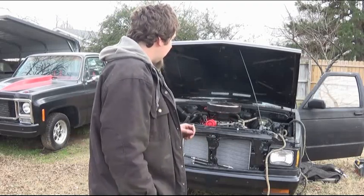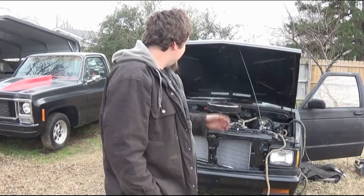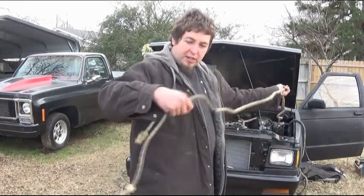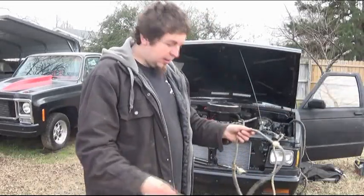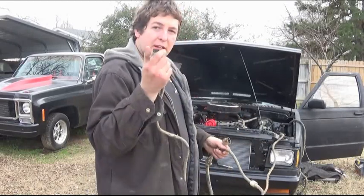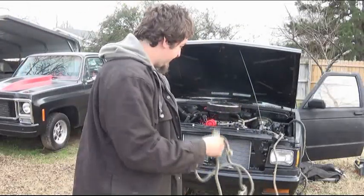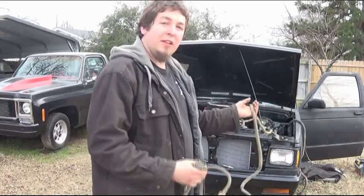Now, some of the only problems that I may run into in tightening this up and making this wiring look good is actually the length. Such as this part of the harness itself, which is actually quite long. This would have actually went down under the cab, along the frame rail, to the fuel pump, and then to the back harness for the tail lights and everything back there. Now, that was a heavy half and it was a long bed, so I have a lot of excess wiring here.